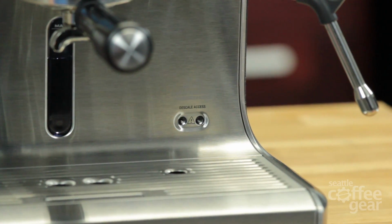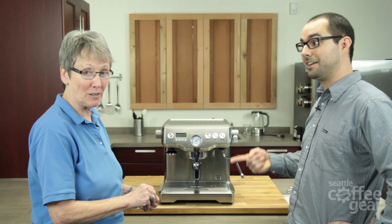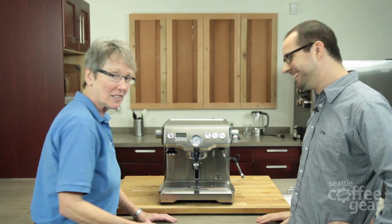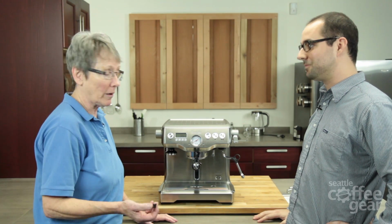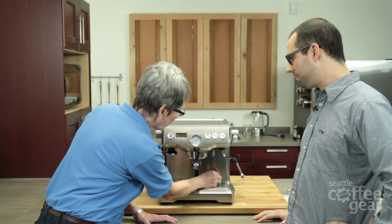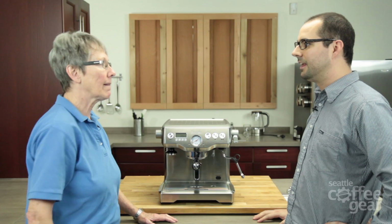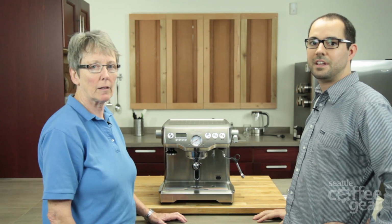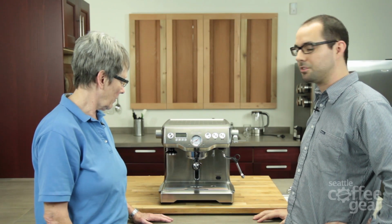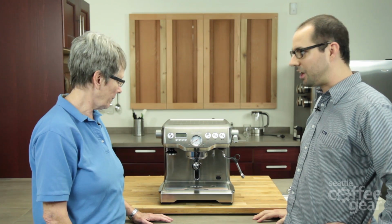And what's that good for? Descaling? Descaling and shipping. Exactly. So you don't freeze the boiler, because quite often people will ship stuff in and it freezes during shipping. And I think that was one of the main things we heard about the 900 was, it was a great machine, but that is kind of high maintenance, having to take your machine into a certified Breville service center just to get it descaled, because you might need to do that fairly often.